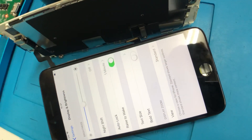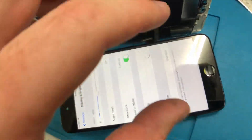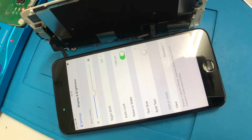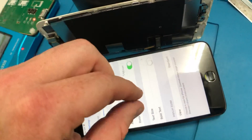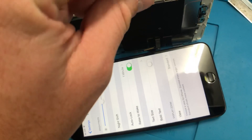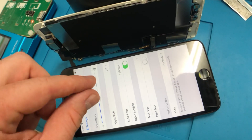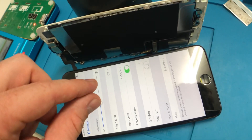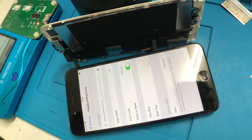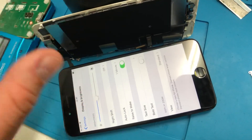So if this was a repair for a customer, and if the serial on this display were encrypted the way it is on iPhone XS and above batteries, we could not rewrite the serial number. Purely because this display has a different serial number to the original, the operating system checks the display's serial number on its boot sequence. If the serial does not match the original — which is programmed in and which the Apple cloud-based database sees — then the software feature of True Tone will be disabled.